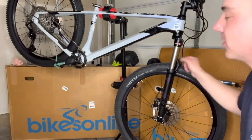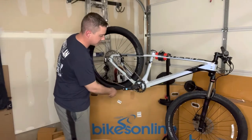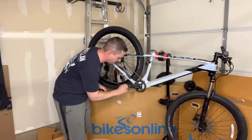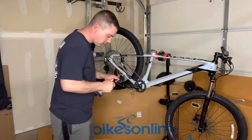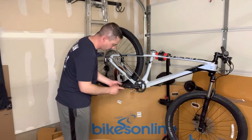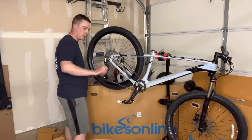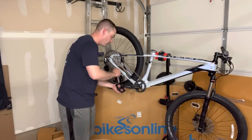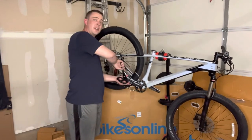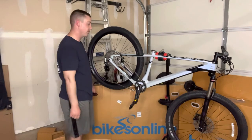This thing looks killer — that fork looks pretty cool. The pedals are labeled left and right, and so are the crank arms. We'll peel the sticker off — it's covering up the old Deore logo. Make sure you get the right pedal on the correct side, as they usually thread on forward. Use the spanner wrench they provide to finish putting these on, and you don't have to crank them down extremely tight, especially with aluminum crank arms — you could really damage them.